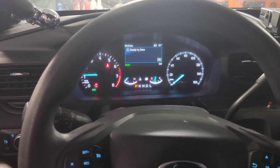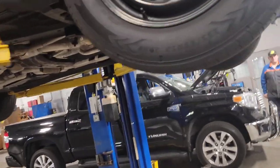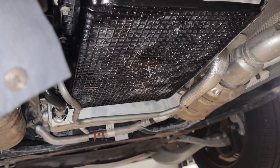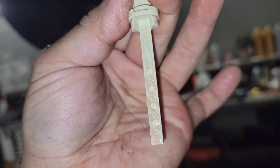I started the vehicle after putting my 5 quarts in, let it run a while with the AC and everything on to load up the system — because this is a hybrid, it will shut off and turn back on. You want to check this at idle, in park, and warmed up, so you can get your hand on the dipstick and pull it up and measure properly. When it's cold it should be right at the tip of the measuring stick, between the end and number 6. Ford decided in their infinite wisdom to number the stick backwards — you're reading from 6 up instead of 1 up. The optimal fill range is between 4.5 and 3 on the hash marks. At first with 5 quarts it looked full, even when the temperature read warmed up, but it looks like it might even need half a quart pulled out.